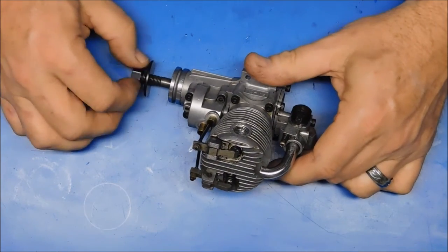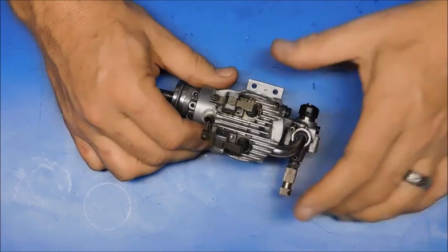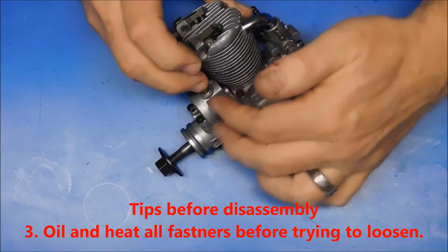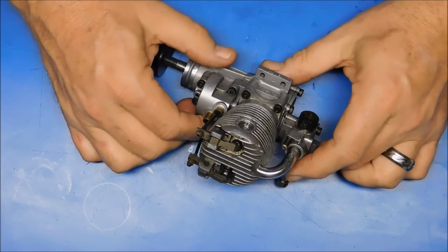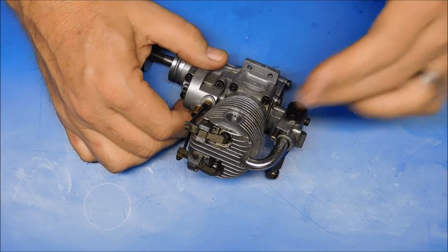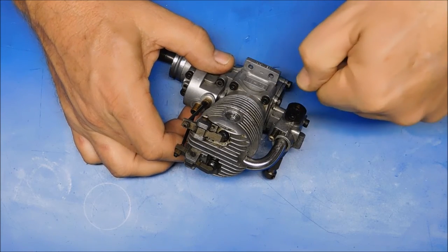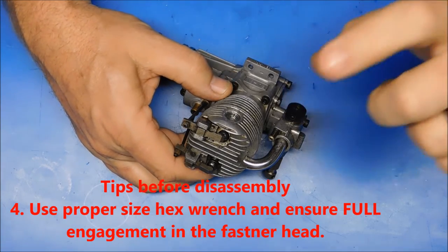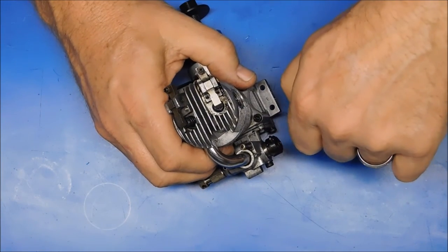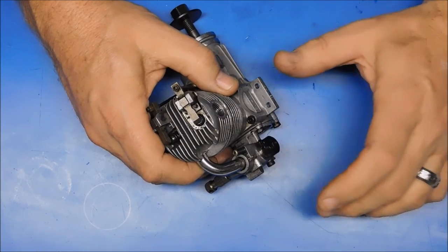These things are not fun to deal with and potentially disastrous, so clean your fasteners out. Before you ever attempt to remove any fastener from a used engine — especially if you had to do any of the steps I mentioned to get it to turn over — drop some 3-in-1 oil or penetrating oil on all the fasteners and heat them up extremely well before you attempt to loosen them. That will give you the best chance of getting them loose and out in one piece without drilling. Make sure the heads are clean, use the proper-sized wrench with full engagement, and only then begin to loosen. If you think the head could be stripping, stop, oil it, heat it up again, and then attempt to loosen.